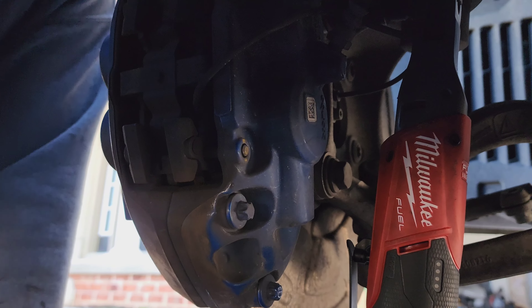I also like to apply a little bit of anti-seize to the little areas that the brake pad slides along — right along here they slide this way, so put some up here and some up here. If you're wondering which way the rotor goes, these little vent things face forward — that's the way it came on the car. Just clean it and wipe it off because it comes with some grease on it so it doesn't rust.